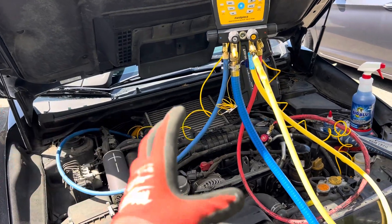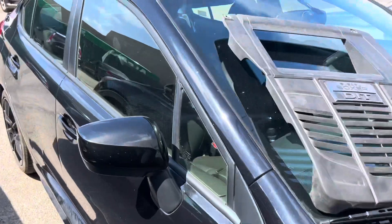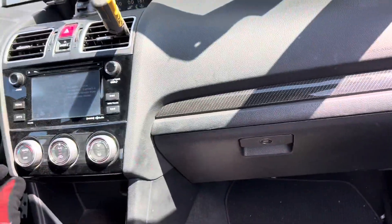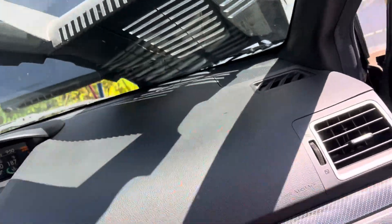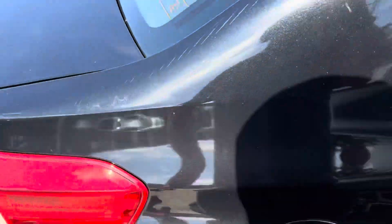Under these ambient conditions, the program kicks out the clutch at 43 degrees. Now I'm going to open up and load the evaporator — open up the doors and windows, release the doors, take it off recycle mode. So now I'm taking that hot engine heat in, which on a cool day is not too hot.